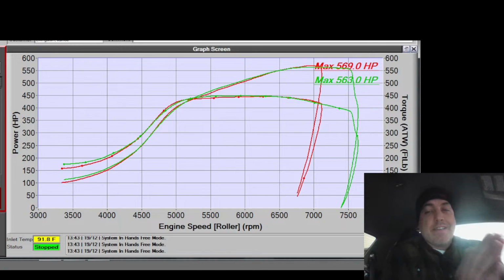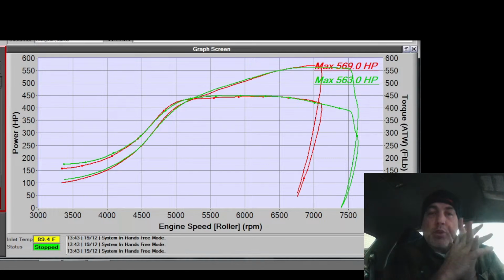But I gotta tell you guys, you gotta be paying attention for this. This is important. These G turbos, they will trick you into blowing them to pieces. What's really important to understand is that if you look at the compressor maps, they're very, very efficient at the limit. They're more efficient than any other turbo on the market at their speed limits. So at their shaft speed limits, they are still in like the high 60s, low 70s for efficiency. No other turbo's doing that. They're all falling off at the limits. So what happens is the compressor is so efficient when you're operating it at the limit, you don't know you're at the limit.